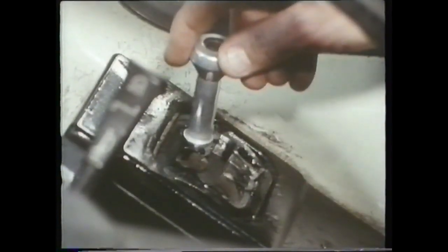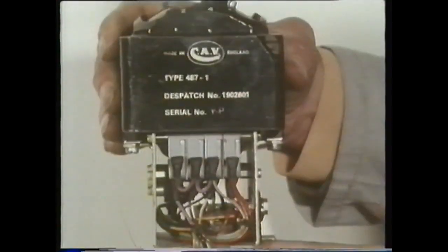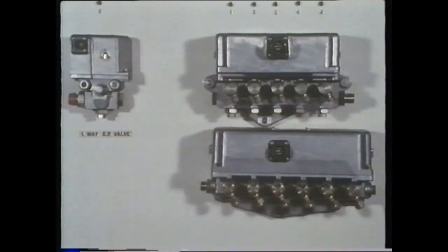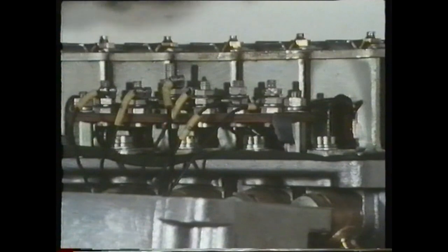You'll also come across this type of change speed unit. Again, always check the connections, both to and from the unit, are secure and clean. This is the location of the two-gear trip-out assembly. Here is the range of EP units in service. The six-way EP is at the bottom. Above it, the five-way EP unit is used both as a four-speed control or with the single EP unit on the left to control a five-speed gearbox. On the earlier five-way EP unit, the valves can be operated manually by depressing the top of the units, like this, to operate the air valves.